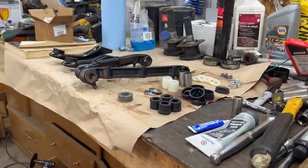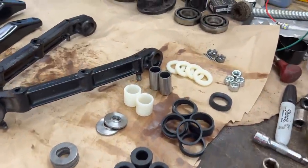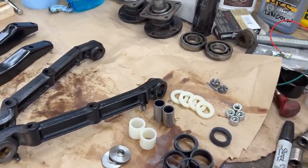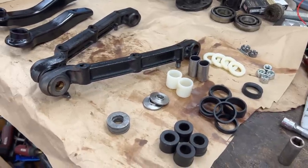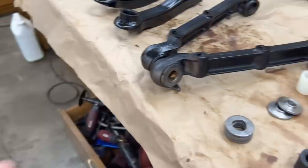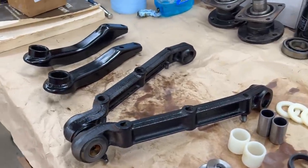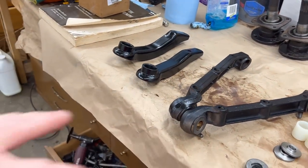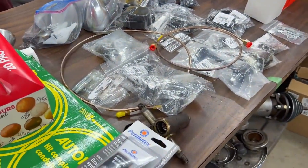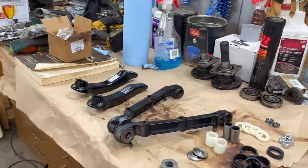All right, here's the kit broken down by side, so it's a little less daunting looking. So you'll know basically that you need to use all these parts on the table if you get this reassembled correctly. Again, I didn't include the bronze bushings. They would go here in this end of the suspension. This would be attached to the car at the rear frame or rail, and this would be at the front where the trunnion is. And actually we need to clean the trunnion up still, so I neglected to do that yesterday. So we'll get the trunnion cleaned up and polished up before we go much further.